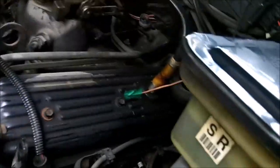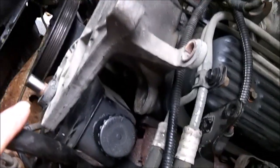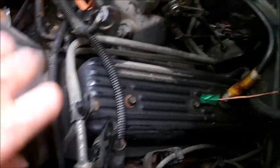Because really there's no need to take this off all the way. So all that work didn't really need doing. You got 2 bolts that hold on to the head, and you have 2 or 3 more that hold it onto the block. So this stays in place, the head and bolts, and it just comes off. Now I'll go ahead and start undoing the exhaust manifold.